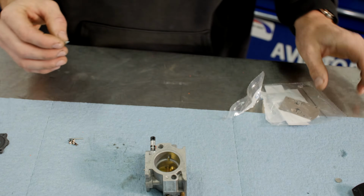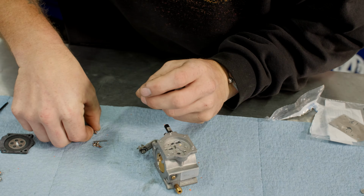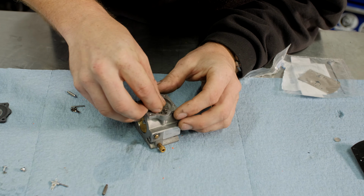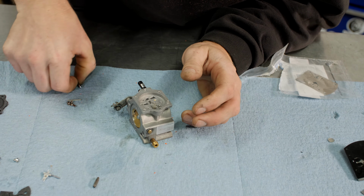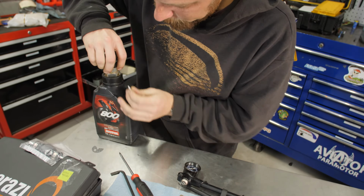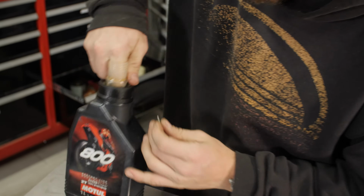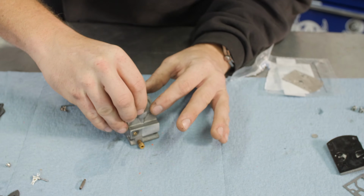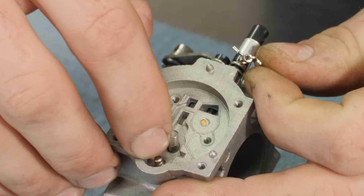and our brand new needle. So we'll start with the metering lever and needle. Remember this spring? This is where the pop-off pressure is introduced. We will talk about that here in a minute. I'm going to take some two-stroke oil and put it onto the end of this needle. Just a tiny dab is all we need. And you'll see why I'm doing that here in a second. Set that in there. Metering spring here, and then the needle goes in this big deep hole here.